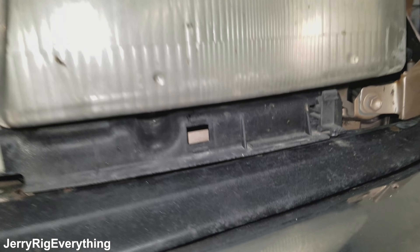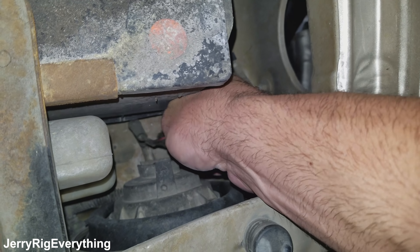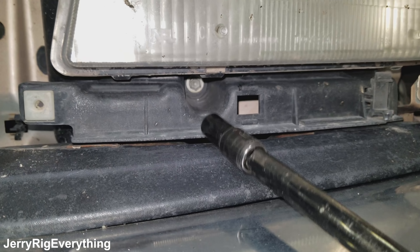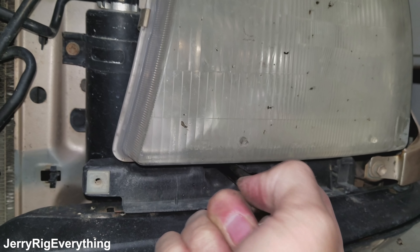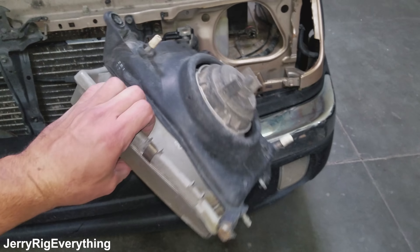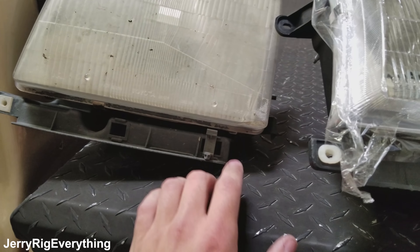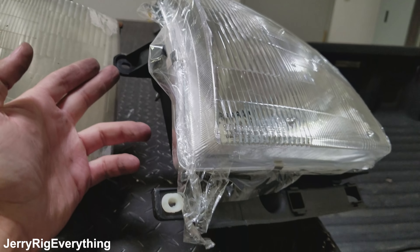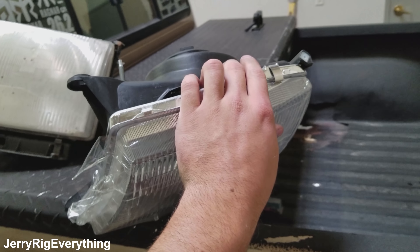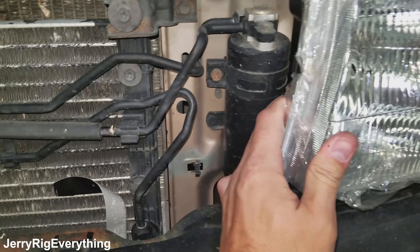The headlight bulbs can actually be taken out with the headlight body or lens still in place. We're going to unplug that, and the last bolt we have to worry about is deep inside of there — still working with the 10mm. I'll stick this in the hole and ratchet it out, and that allows us to remove the whole lens assembly. I'm going to put the lenses side by side and make sure I'm not missing anything. There's one little clip at the bottom for that metal panel I have to move over — the clip is transferable — still have the screw hole for the back, front, the two pegs for the side, and the screw hole up top for the side parking marker. I'll take the new lens, tuck it into those side holes, and line it up.